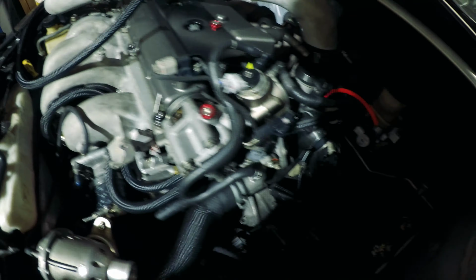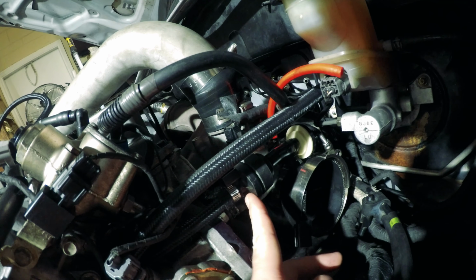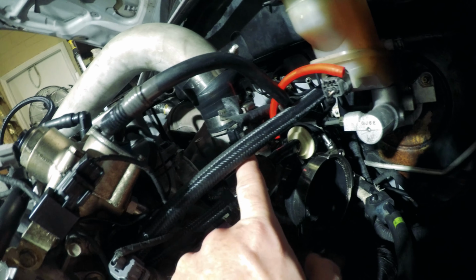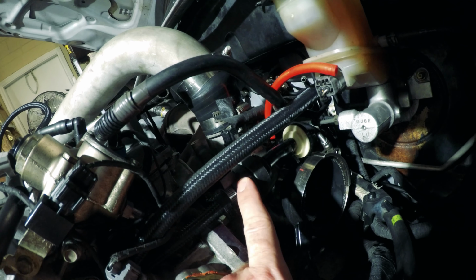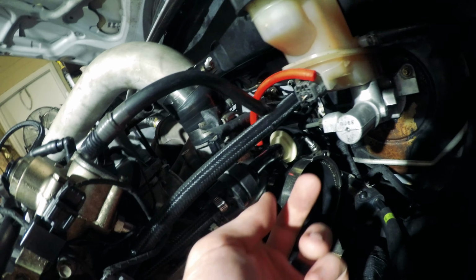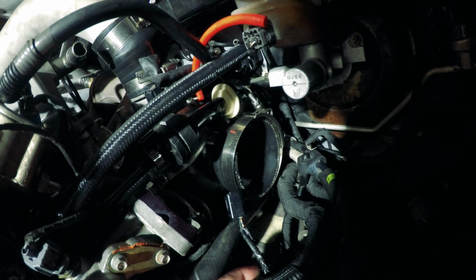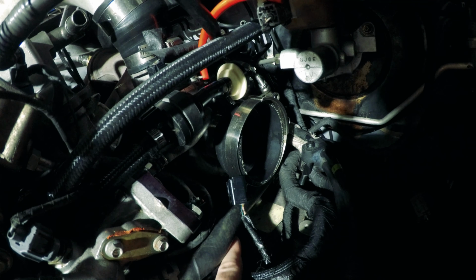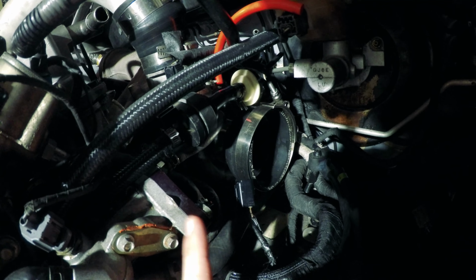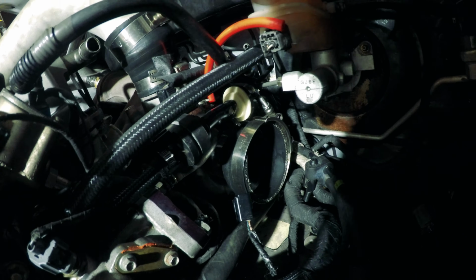And then I'm not sure how well the camera's gonna pick this up, but back here, I have the purge valve tucked nicely. I'm gonna fab up something to hold it onto this boost control solenoid bracket here. That way it doesn't move, but as it is, it already doesn't move that much, so that'll be pretty cool. And then just running the harness here that I've untucked, and normally I had it running underneath this hose here, so I'm just gonna run it straight up and around, plug it in, nice and neat. Tape this bad boy back up here, and done deal.